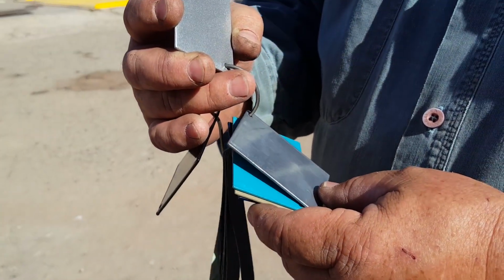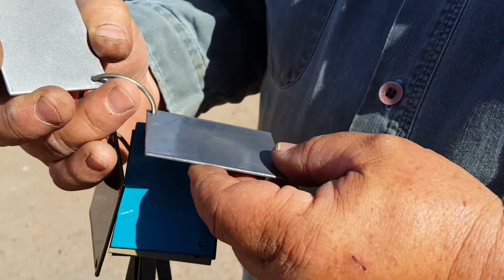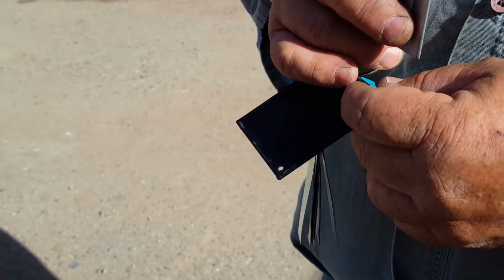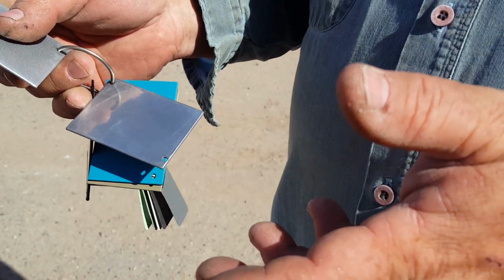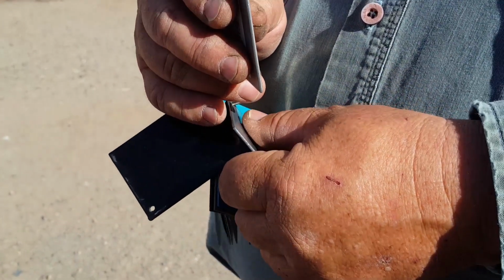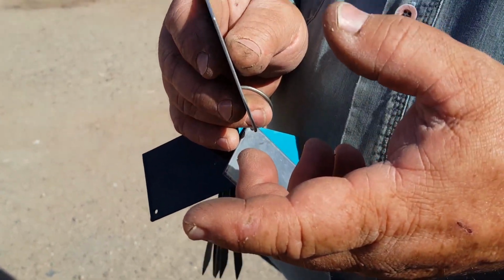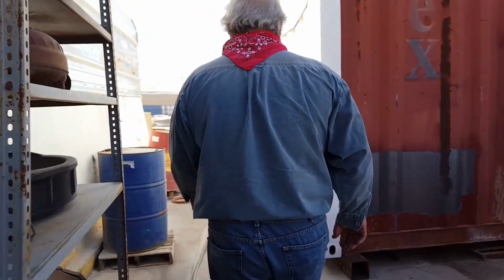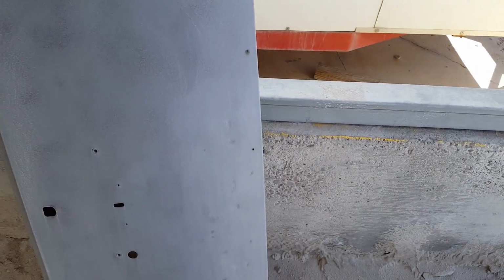Is that why you sometimes see an orange peel effect on parts that weren't cleared, that were coated? Well, I don't know if that's the right word for this texture, though. Actually, it is, and that isn't the reason why. It's an industrial coating. It's plastic. It's over a rough, finished substrate. And if it's a big flat surface, it's going to look peely. It's going to look a little less peely with the clear. You can match paint to powder all day, but you can't match powder to paint unless you buy 50 pounds of the stuff. But in the meantime, we're going to go with just a plain silver on the wheels like they did from the factory.